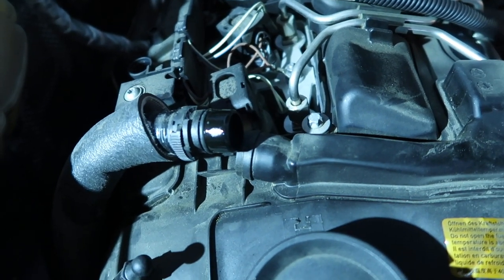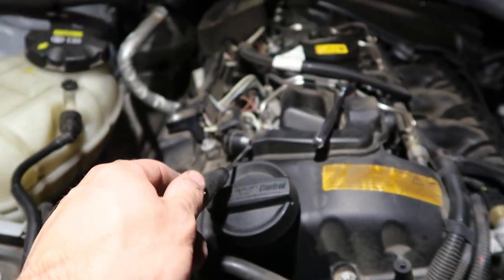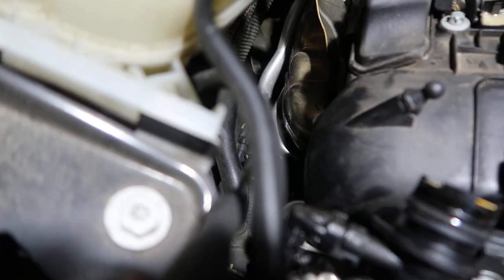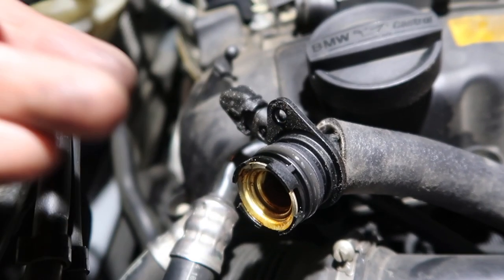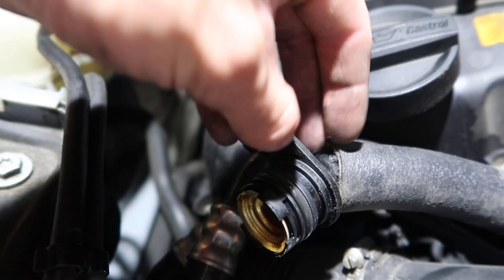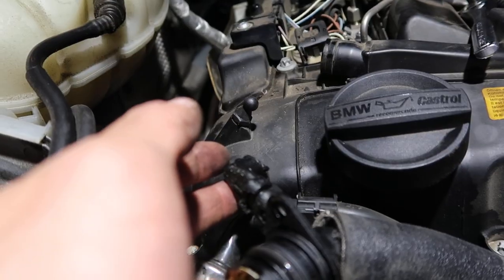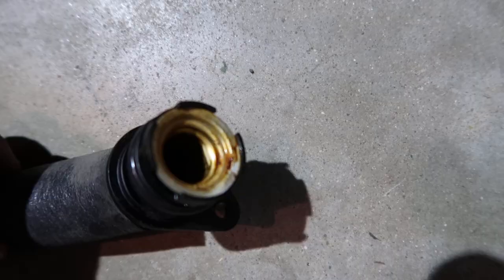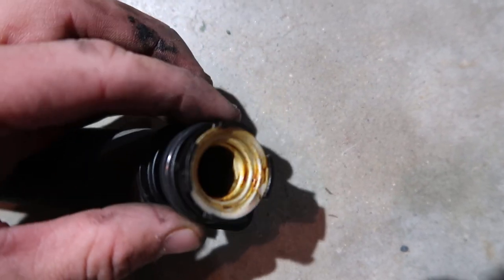I'm sorry, this is kind of bright. The only shop light that I have is LED and it's showing up brighter than it needs to. After you unclip the top from here, you're going to have to follow the hose down in. It goes in down underneath there. There's a flange that looks like this that has one T25 Torx head screw in. It's kind of tough to get to, but once you get that out, you can gently wiggle it and pull it out. You're going to have to unclip this sensor, then undo the steps that you did with the new one. I would imagine this is the hose from factory, so this has about 75,000 miles worth of life out of it. This is the end that connects to the crankcase — there's definitely some oil gunk in there, and that's just what we're trying to avoid going back into the intake and the valve train.